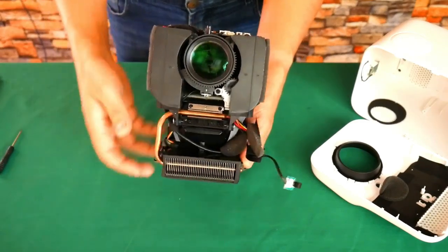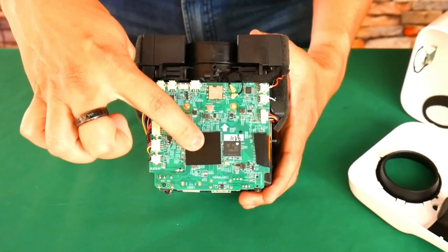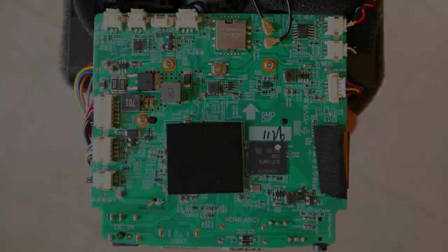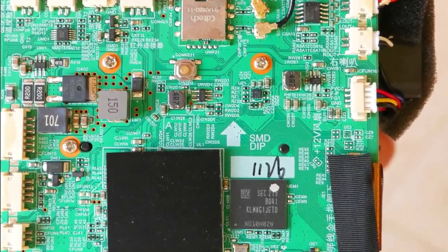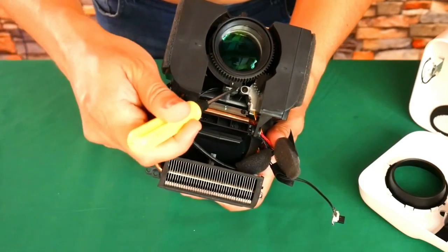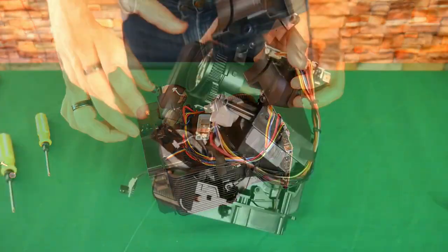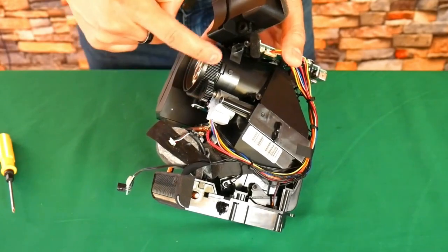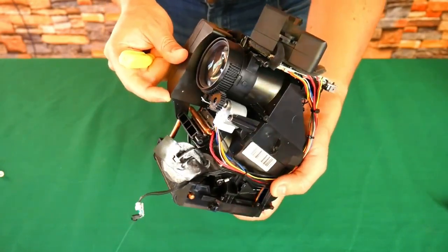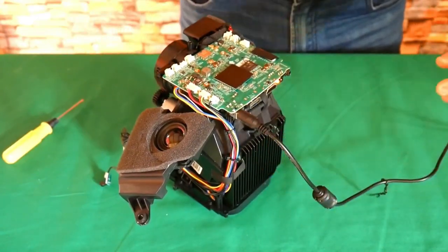There are two front and rear infrared sensors to control the T4 from any angle. The integrated card is the MediaTek MTK 9269 processor with integrated storage chip and dual-band wireless module hidden in the back. Deep inside the card is a tiny accelerometer and gyroscope microchip. Another new feature is the electronic focus: a small stepper motor controls the rotation of the lens element. Unlike a regular motor, a stepper motor only rotates a small angle per step, making it more precise.